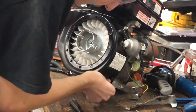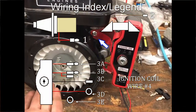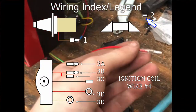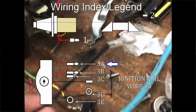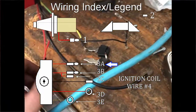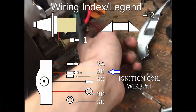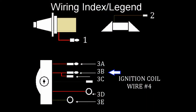At this stage all the new kit components should be mounted to the engine and you're ready for the wiring stage. The starter solenoid has a red wire with a male bullet connector attached. The charging coil installed on the engine has a brown wire with a black hose and a female bullet connector. The switch box has five wires: a short red wire with a male bullet splice connector housing a diode or rectifier leading into the fuse block; a short black wire with a male bullet splice connector followed by a female splice connector; a long black wire with a rubber hose and a female bullet splice connector; a long red wire with a rubber hose and an O-ring at the end; and a short green and yellow wire with an O-ring at the end.